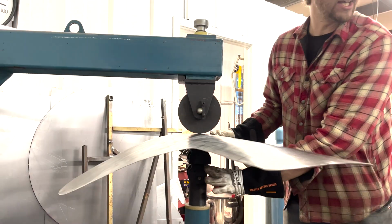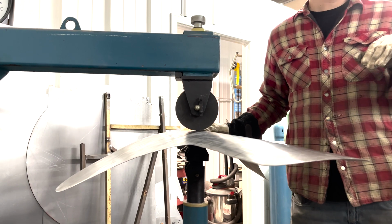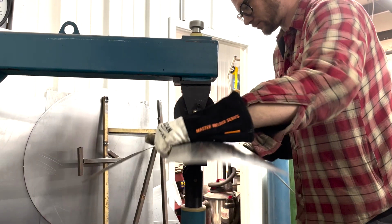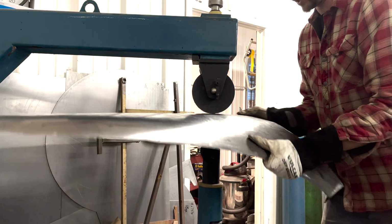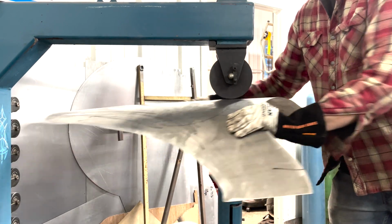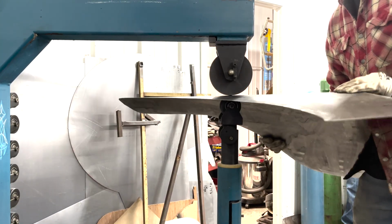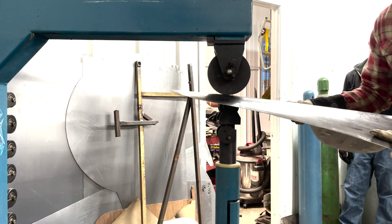With having a little bit of a flat spot on the bottom die, you really don't want to have too much pressure on it because it'll put little ridges in it all over the place. And we're getting a little bit of that, so I'm actually going to back it off again. A lot of it's knowing your tool, knowing how to work it. Like I said, it doesn't matter if you got a Harbor Freight English wheel or a fancy Bailey one. I prefer this one. That's what I've got at home, so I like it. But again, having that 40-inch throat's really nice. And if Bailey wants to sponsor me, go ahead.